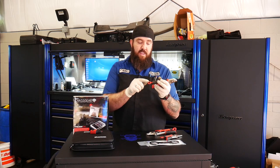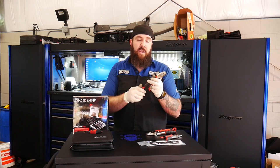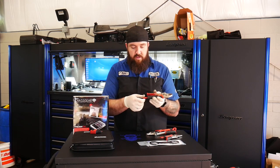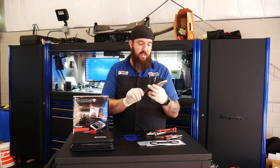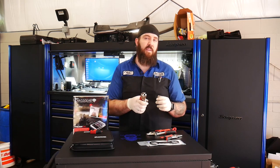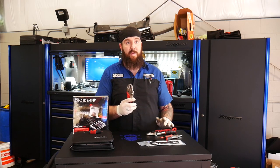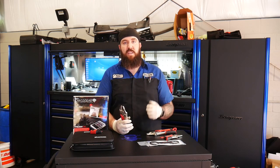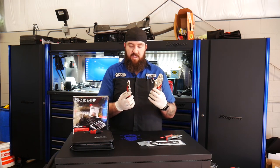I also like the actual mechanism on the end that you twist to change the opening of the locking pliers — it has a very nice coating. Looks like almost a red tough ceramic coating. These things are amazing at grip and do not wear out nearly as fast as what I'm used to with the standard Vice Grip brand. You can clamp these on nasty tie rod ends and get your nut off without them spinning too much.